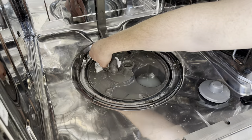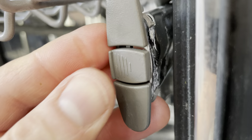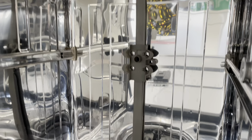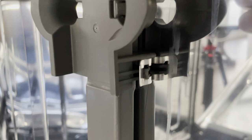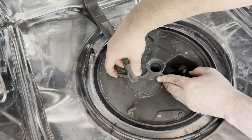As I drained all the water I didn't see anything in the filter cavity so now I need to remove this wash blade extension so I can look inside the pump. To take off the top wash blades I need to remove the rack by undoing these clips and then it can pull forward on the wheels. To get to the pump underneath I have to take this top blade off — in most cases it's held down by these clips. I'm just going to gently bend them and they'll come right out. There's also probably going to be support clips in the back that you'll have to remove. Once that's taken off I can unhook it and look inside the drain that goes out to the pump. However when I opened it up there was nothing I could see that was blocking the pump drain.